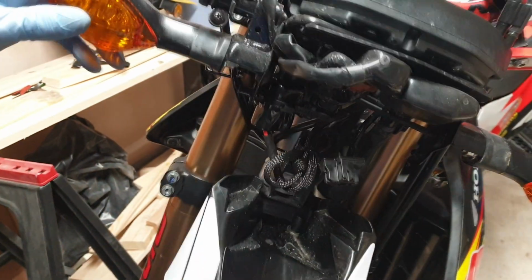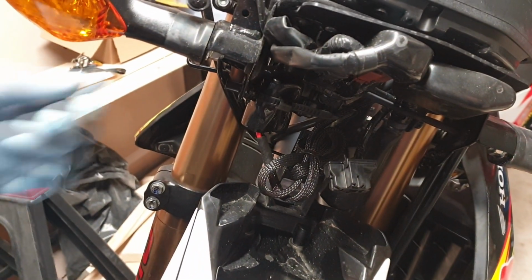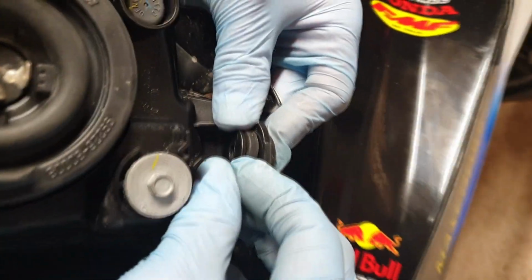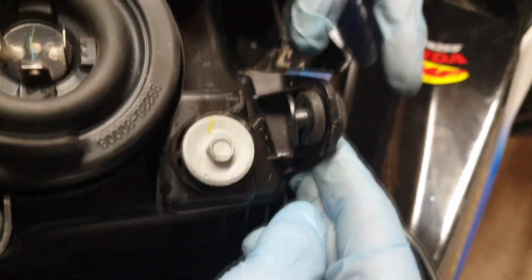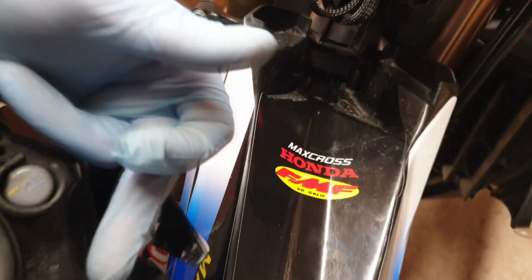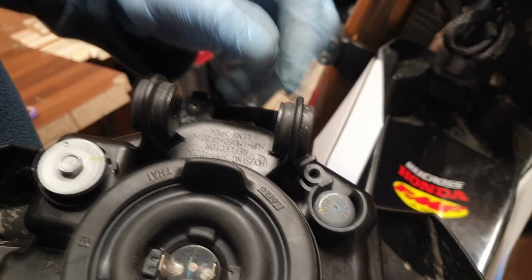Like I say, it's a reverse of how it came off, so you've got to go from this side to this existing lug spacer that goes onto the first one, and you get top hat spacers in the actual headlight. Let me just show you. Make sure you retain all these, as they can pop out, and when you're trying to mount it onto the existing bracket work, they foul. So make sure they're in. There'll be 3 of those, one there and 2 at the bottom.